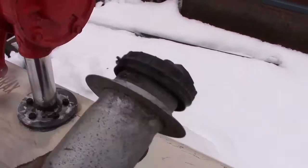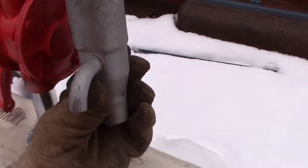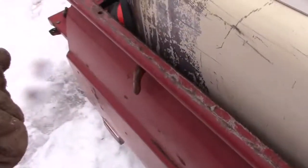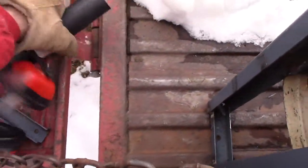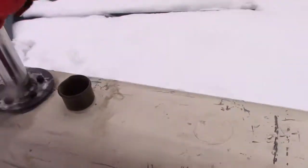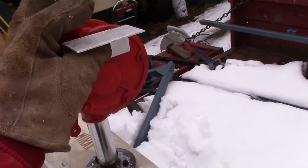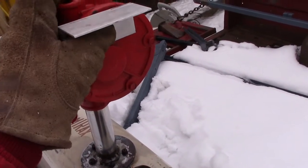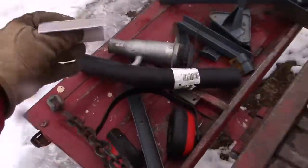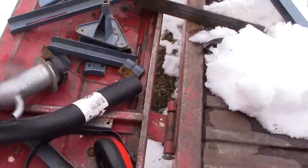And that's going to go right up there. Well, I can't just have it flippity-flopping around. I'll get some Gates fuel hose. I'm going to make a little piece of angled aluminum and cut in an inset for that filler nozzle. Then I can use the mounting holes it already has — just two of them, but that'll be good enough.